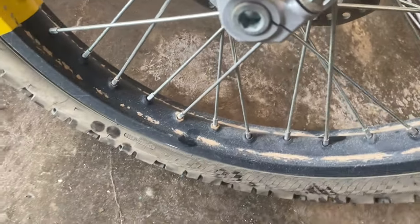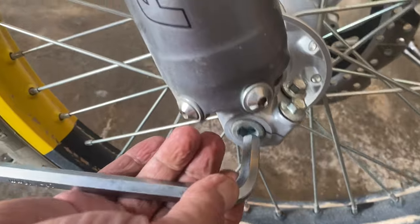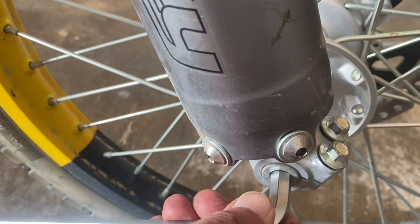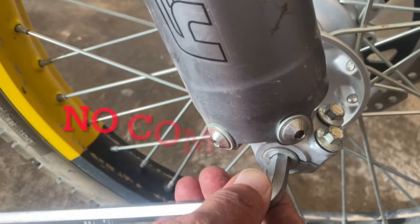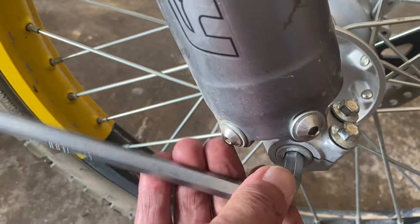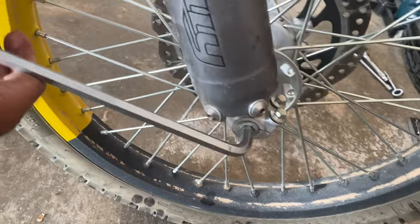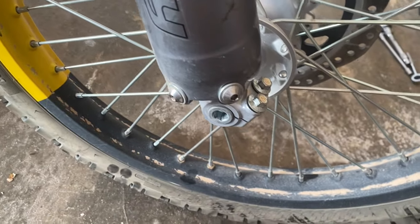To get the axle bolt out it's a 10mm allen key. I was concerned because it was really wobbly in there — I was wondering if I needed a bigger one — but I couldn't get a bigger one and I was concerned it might strip. But I put the boot in on the end of the allen key and it came off straight away, so no problem there. 10mm allen key.